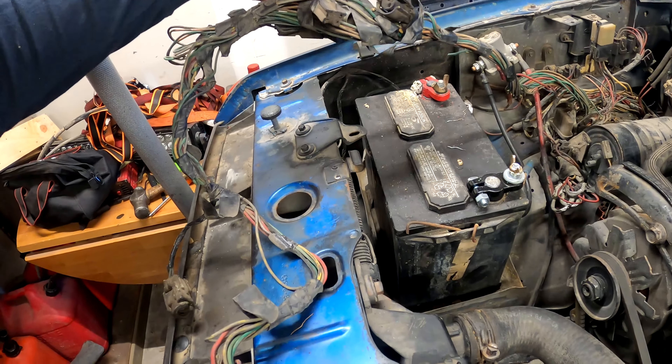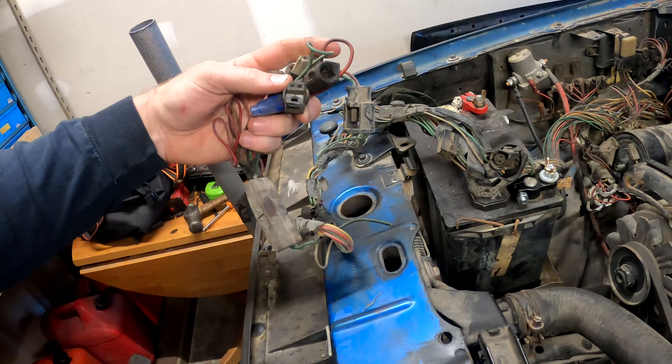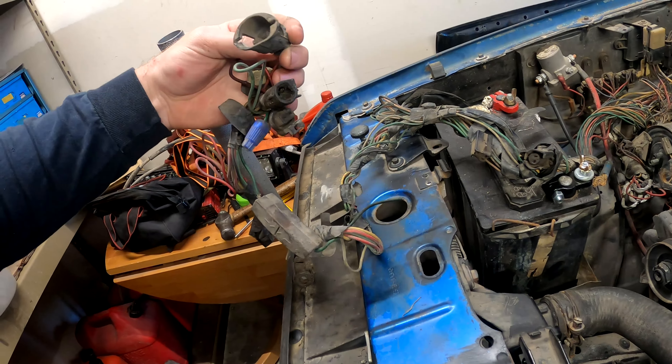When we were out here looking through everything, there's this bundle of mess of wiring. If you guys watched the previous video with my chuck wagon, I had to go through all this crap and rewire that thing. There's some plugs here — an inline fuse, an injector harness, a MAP sensor, and other miscellaneous stuff. Down here is all the original 2.9 wiring — the old clip for the ignition box that goes on the back of the distributor, and all the evap control system stuff, which isn't going to do anything since this is carbureted. So we're going to go through all that, and if needed, I'll just make the computer out of it and pull all that wiring out.